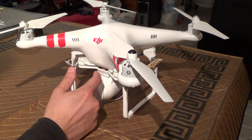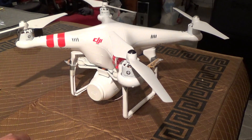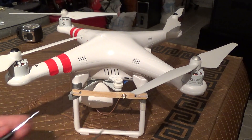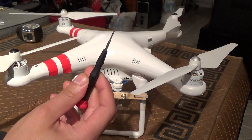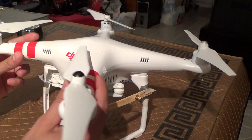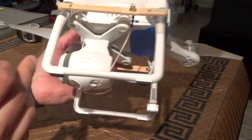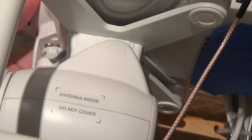From what I can tell, it's a standard micro servo with just a couple of fins removed — fins that are usually used to screw it onto a surface. What you'll need is a Phillips screwdriver, a really small flathead screwdriver, and another one that's a little bit bigger.